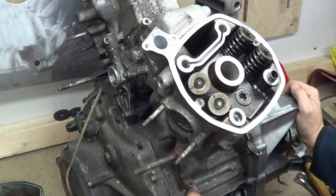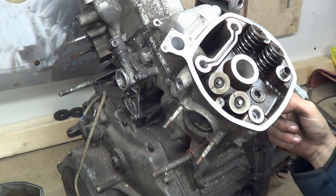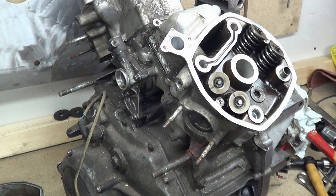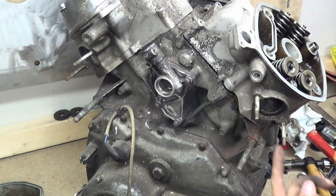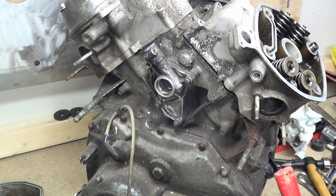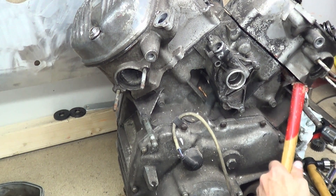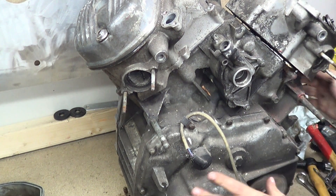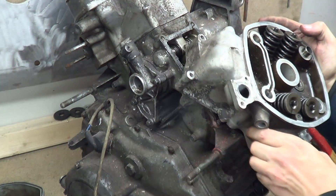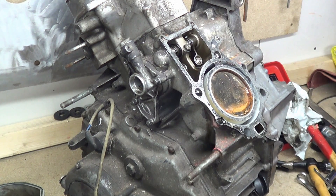Let's move it back into view. After a lot of whacking there are two dowels - I can see this one and that one broke through first. This one on this side has been a pain because this is the exhaust port, the hottest part of the cylinder head, and this will cause the engine to swell. There we go - break that bit off, wiggle that off, and booyah. Holy shit!